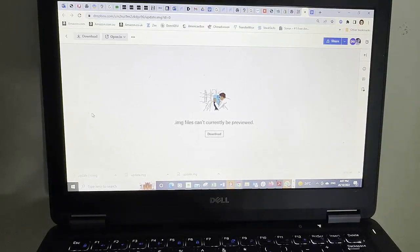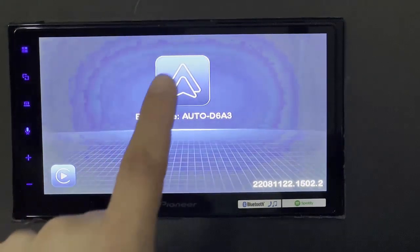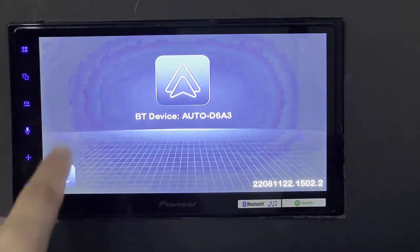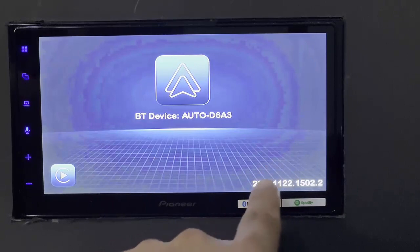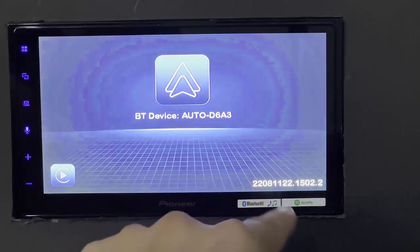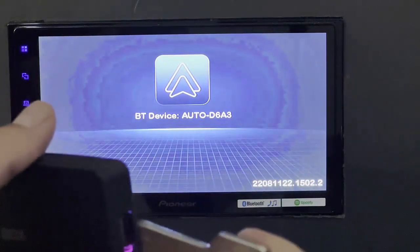Now go to the CPAA and the car radio. Here we have the car radio with the CPAA connected to the USB port. This is the screen you normally see when the unit is connected. A couple of things to notice: if you have Android Auto, make sure the Android Auto logo is in the middle; if you have CarPlay, double-tap and the device will reset and the CarPlay logo will be in the middle for connecting with iPhones. Also notice this number here is 2208 — with the software update for LDV models, this number is going to change to 2203. That's how you can verify if the software has been uploaded or not.